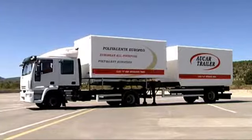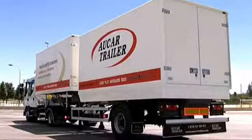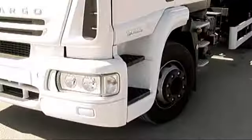In order to align the trailers again, the support legs must be retracted and the service actuator pressed to release the brakes of the semi-trailer. The instructor activates the wheel alignment system and steers the wheel as far as possible until the amber light goes on.